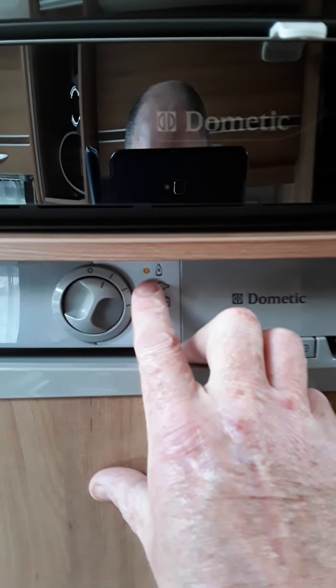So that's your control panel. The next thing we're looking at is your fridge, working on this control knob. At the moment it's off - at zero. The first setting is gas; you just flick it onto gas and it'll ignite itself. There's no pushing buttons or anything, just flick it onto gas and it'll come on. Now if the light stays solid it's lit. If it starts to flash, your gas needs to be switched on.